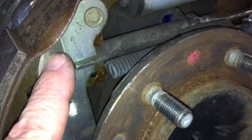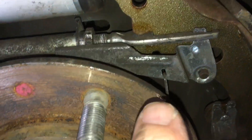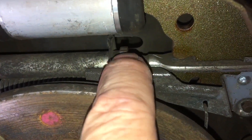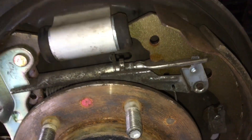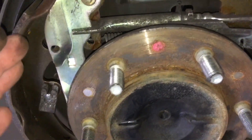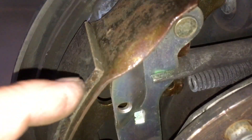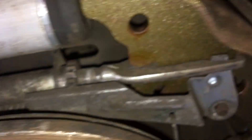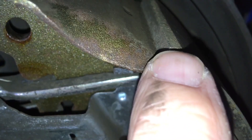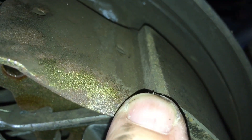You can see this is your handbrake lever here - this is where it comes in. To adjust them, obviously they have got an automatic adjuster setup which works sometimes - probably better on Toyotas than most other cars - but this is your actual adjustment, a couple of clicks either way. I'm not going to go full detail on adjusting brakes, just giving you background information on the components. These are the brake shoes - if you've got brakes grabbing and stuff like that - see this edge got a nice sharp edge on it? And this edge, they've folded down the leading edge - you can see that chamfer - it's only going to work for the first one third of wear. Once it gets down to there, you could get a situation of brakes grabbing again.